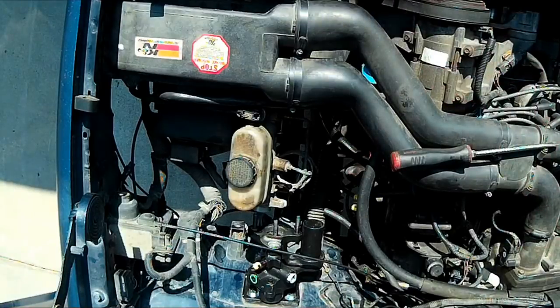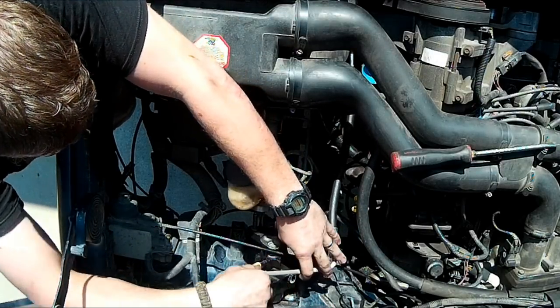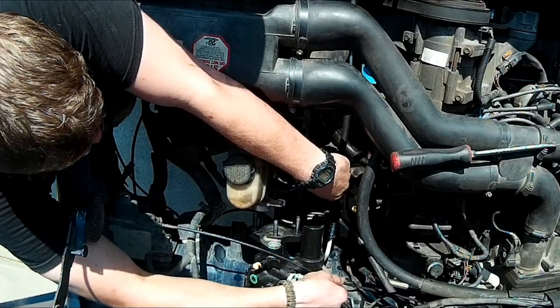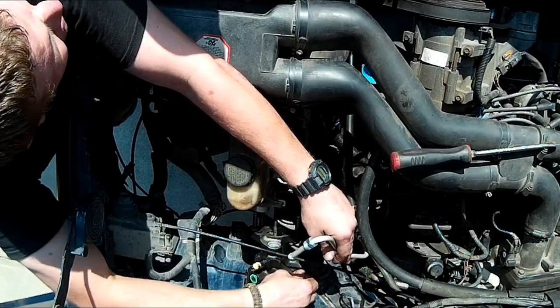Now, you're going to throw the lines on them? We're going to hook up some hoses. Cool. And that'll probably actually pull that belt back off and just crank the pulley by hand to push fluid all the way through it, so when we start it up, it won't suck itself dry and burn up the pump right away. Good idea. There's a crossover to this side. Oh, you're right there, right? Oh, yeah. Connector. Don't get carried away on me, Jim.